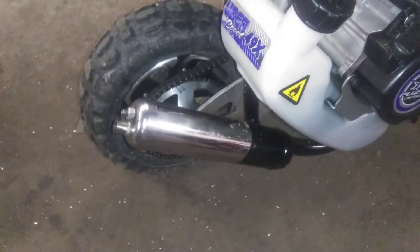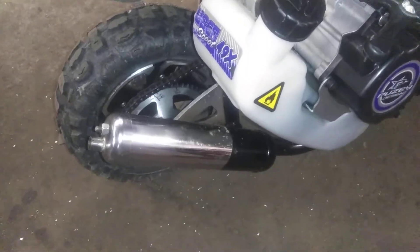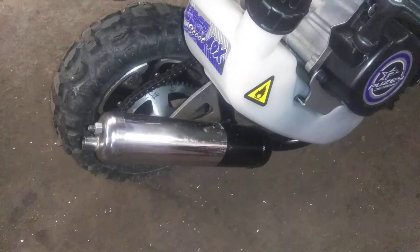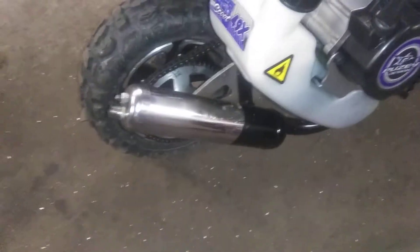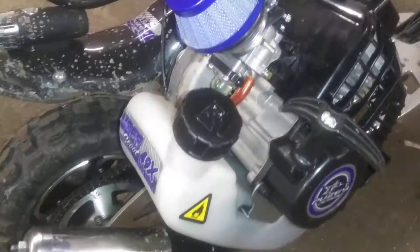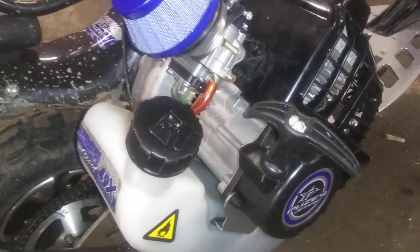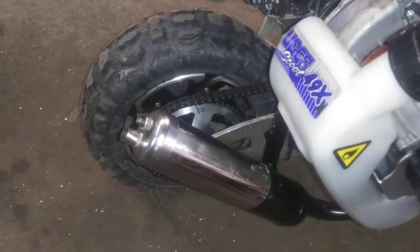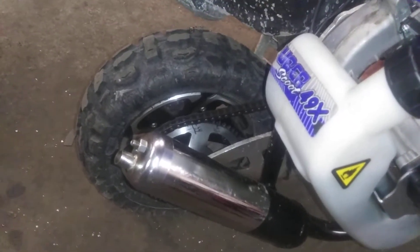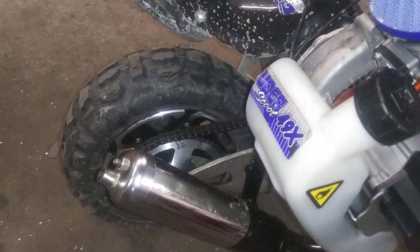I know it's not the Jet Pro. I went for more horsepower over stock, but I still wanted it to be quiet, so I kind of hit the middle ground. I put on a 14 tooth pinion gear over the stock 11 tooth, left the 54 tooth rear sprocket on it for now, and when you move up to the pinion sprocket, you've got to put a longer chain on it.